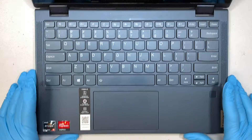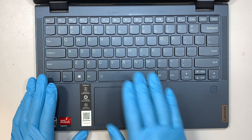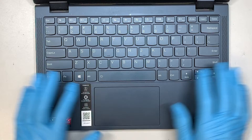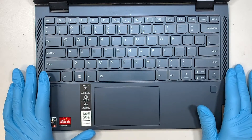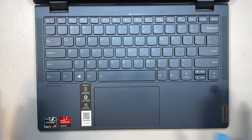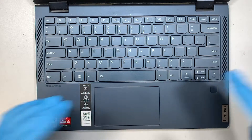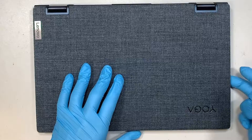What are the signs that you need a battery replacement? Most likely if you feel like your touchpad has a lump or feels like it's bulging, or maybe the keyboard is not working correctly especially by the spacebar or the clicking part — then more likely it would be a battery problem. And of course if the battery is not holding a charge, that is an indicator that it's time for a replacement.